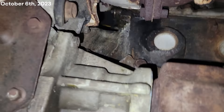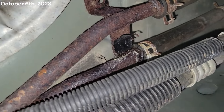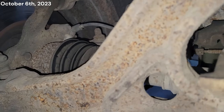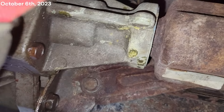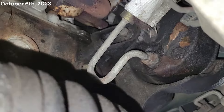This girl's had a slow coolant leak — I just keep an eye on it, top it off, not enough to cause concern. That might be a culprit. The other culprit is up at the rear cooler lines — they're starting to get pretty rough looking and I need to start looking at replacing those. This does not get driven in the winter. All the new suspension parts up there are still shiny. Not much progressive rust that's gotten worse. It's not too bad under here.